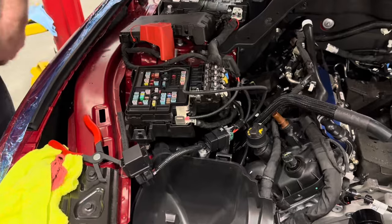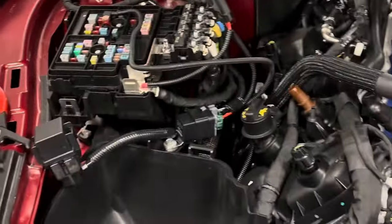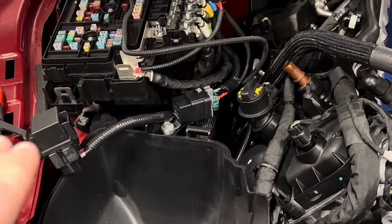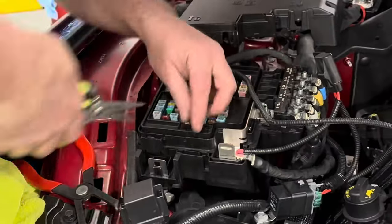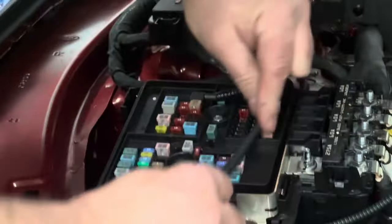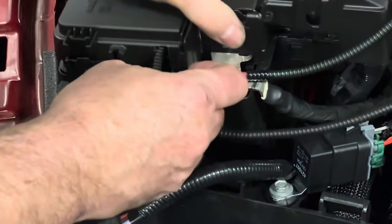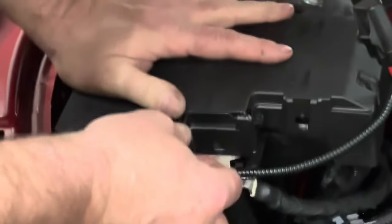After we get the blower on, we're going to get it all polished up real nice. What we're putting in now is some additional wiring for the coolant pump. You get an inline fuse and a relay harness that runs all the way across to control the pump installed earlier. Whipple tells you to notch the box there, but we also trimmed a little piece out of the lid so everything fits in a little bit nicer and clips down without pinching any wires.